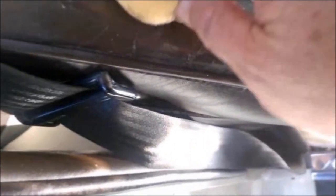This particular colouring looks a little bit lighter when it first goes on. Don't be too concerned, because it does get darker as it dries. The colour of my seat is a chocolate brown, so obviously you'll need to make sure you get the correct colour scheme to match up with it. You may need to get some sort of tinting, and just do a little bit on a test piece somewhere where it's not going to cause too much heartache if you bugger it up.